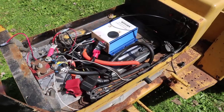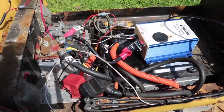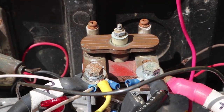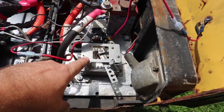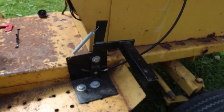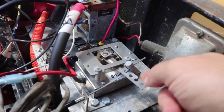Literally this is all junk, so I'm not saying this is best wiring practices or anything like that. All the parts that need to be covered up are covered up, no short circuits or anything like that, but still it looks like a bit of a rat's nest. Up here I do have the main contactor with a pre-charge resistor. I repurposed one of the switches on the dashboard to turn the motor controller on and off, and the key to turn the main contactor on and off. The potentiometer is actually the Curtis PB6 reused from the electric car, and I just used a piece of old brake cable to a foot pedal my brother and I built — just a spring and a couple pieces of metal welded up — that goes up around and back to the motor controller for speed.